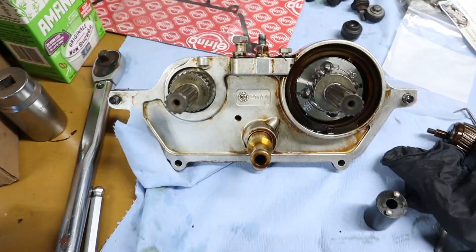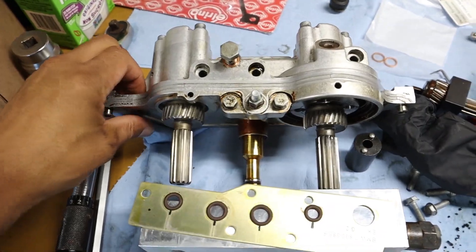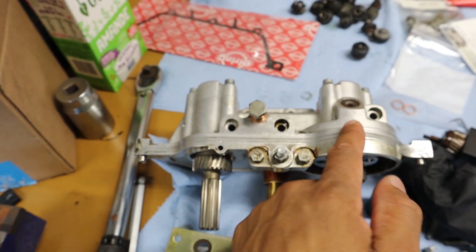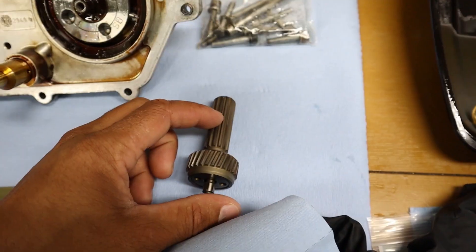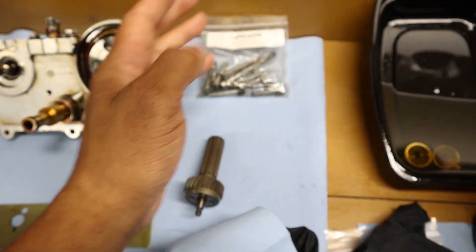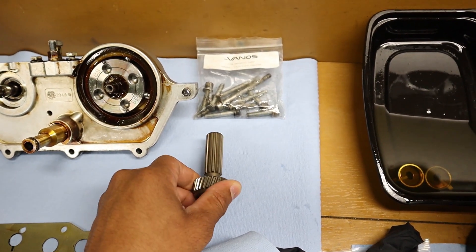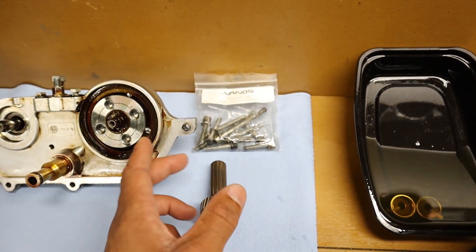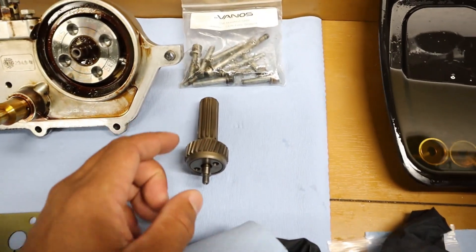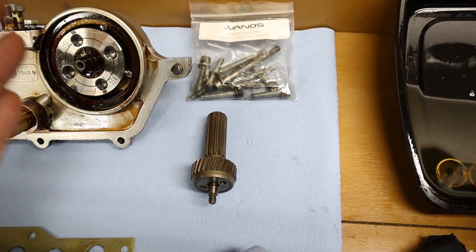So this is how it works. Here's the actual Vanos unit itself. It's already been pre-assembled and I'm just waiting to fully install it. There are two pistons in here oriented like that. These two helical gears are actually fastened with a left-hand thread. This section here will slide into the camshaft, and as you can see since it's straight, it's just going to lock right in with that cam and make it so there's no rotational movement between this and the cam. Now this helical cut gear on the front is cut on an angle — that's known as helical cutting.